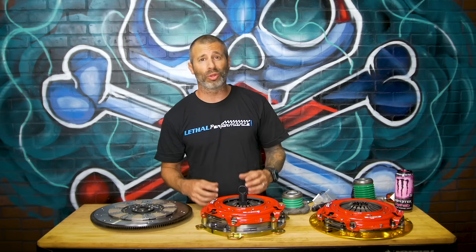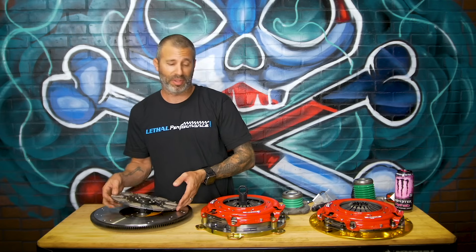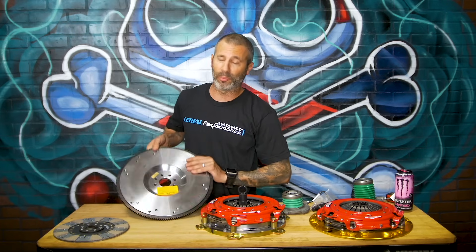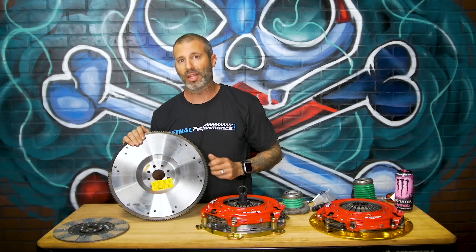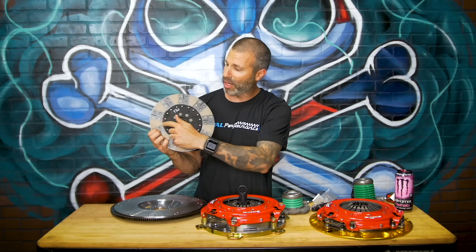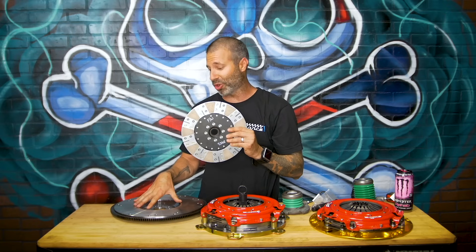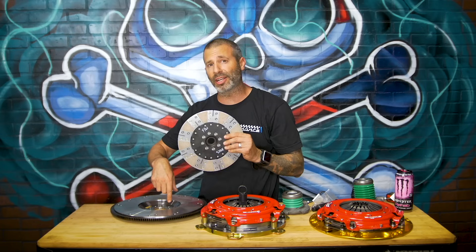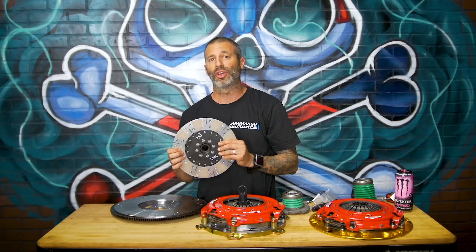The reason why we recommend using that 6918-07 is because the regular RXT clutch kit alone will not work properly with the factory flywheel. A big point of confusion people have is about the flywheel — the factory flywheel has a larger center section than the one McLeod offers. The factory flywheel measures seven inches on that cutout to make room for the hubs for the disc and to bolt to the crank. That causes a problem with the RXT, because the RST and RXT have a diameter on the inside of the disc of about 6-1/8 inches. The seven-inch factory flywheel causes that disc to overlap on the inside where the hub is, which causes premature wear and less surface contact from disc to flywheel. You're losing holding power.